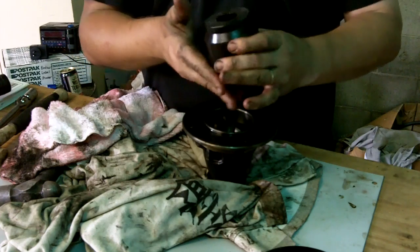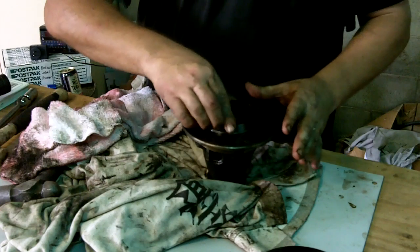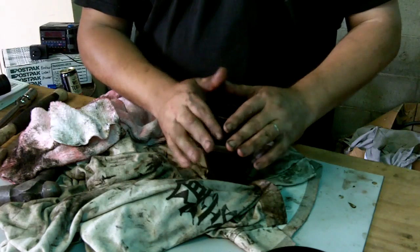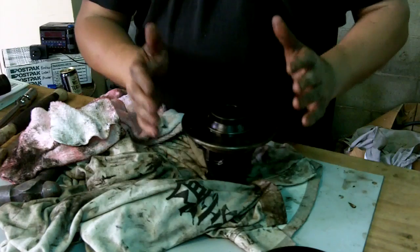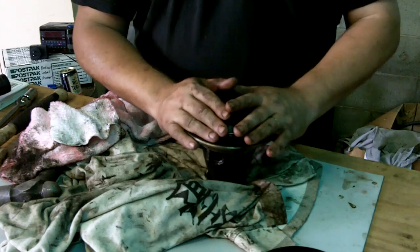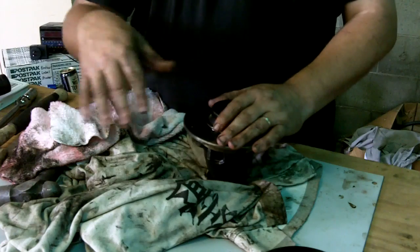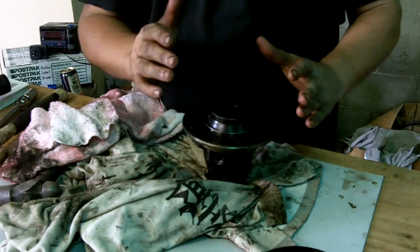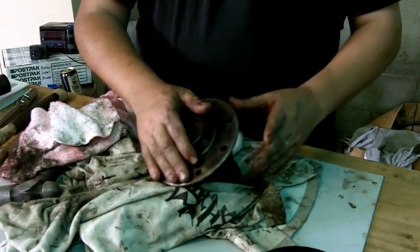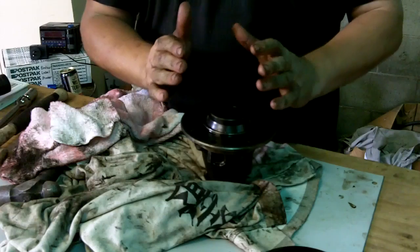There is our carrier with pretty much nothing in it. There's our mini spool — as you can see it's just a big chunk of iron, which will go straight in there. The pinion pins will go through there and lock it into the carrier. When it's locked in, there's no meshing of gears and no gears to fail either. When you turn corners you're going to have a slight chirping effect on one wheel, which is not much fun on the street or in the wet, but for a drag strip it's pretty much perfect because it means we'll fire straight down the strip.